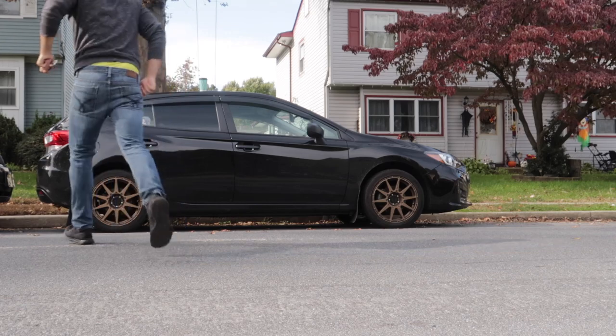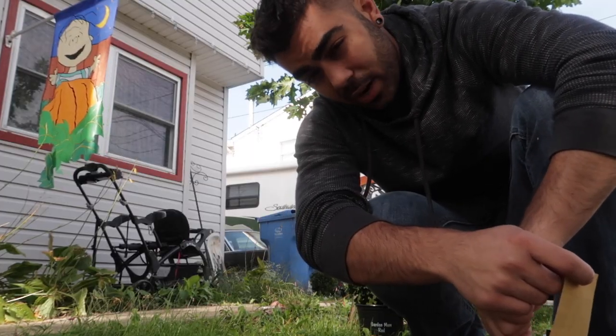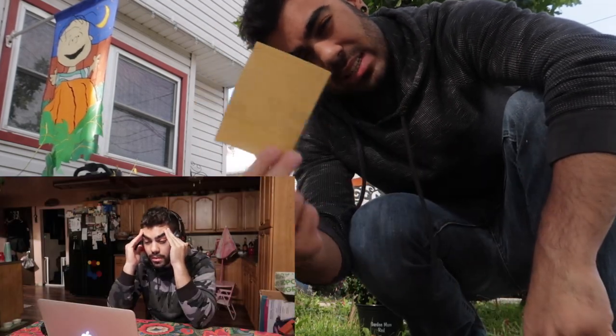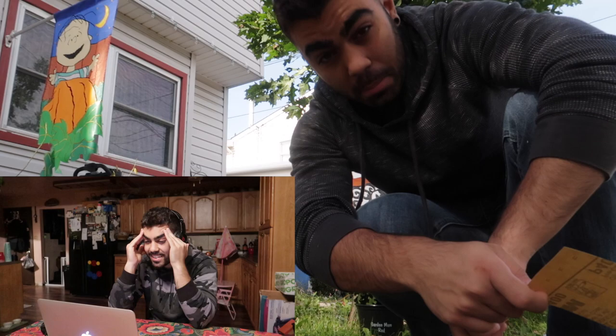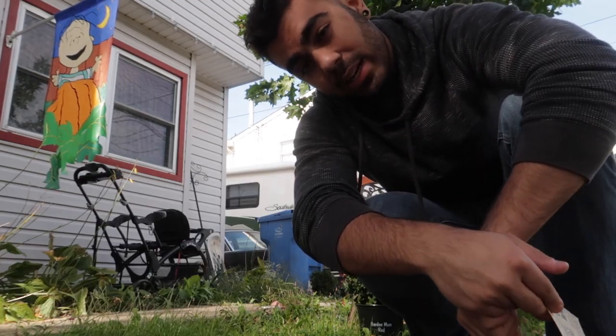Check this out. Since the side skirts are brand new, I don't really have to sand out any imperfections, but I do want to give it a slight sand just so that the paint and the primer stick a little better. So I have some 400 sandpaper. I'm going to give the side skirts a quick sand and rinse, and then we'll go to the paint booth.